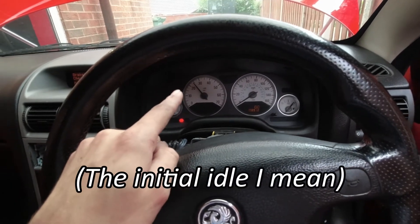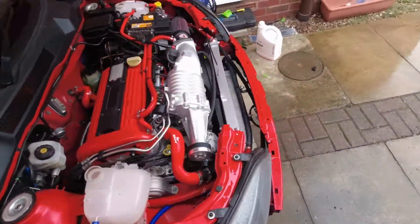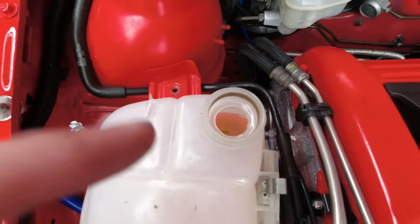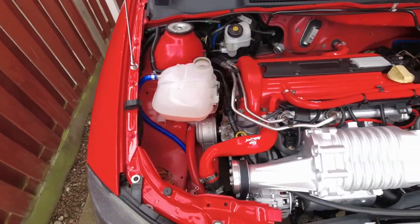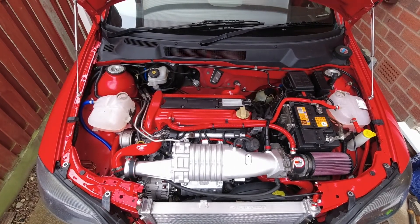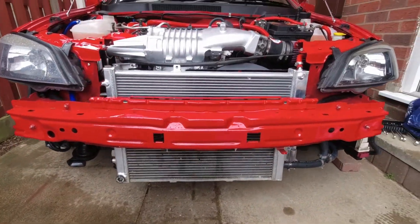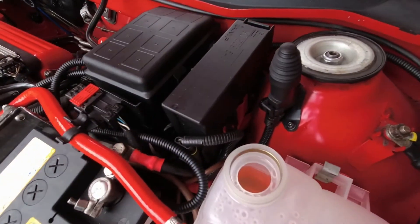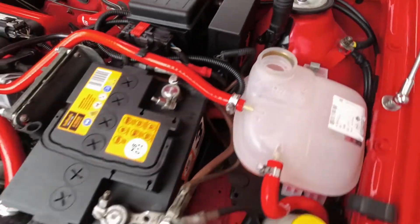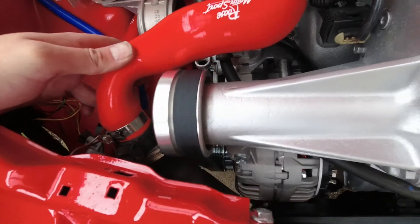This is the moment of truth. The high idle is normal for the supercharger map — we are running! I don't think this pump's running yet though, I need to investigate that. It's got a little bit of a lumpy idle. The coolant isn't circulating either. Wait — we've got a belt rubbing through a pipe, we need to stop.